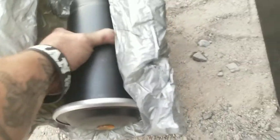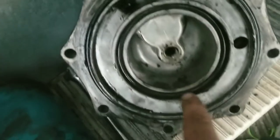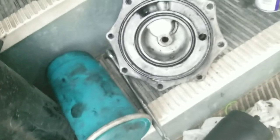This is the new one. What I didn't tell you - in the box you get a bag with instructions. Don't worry about the instructions. All there is in there is two rings: one big one for the outside - this is the new one, that's the old one. Just change them out because they give you new ones in the baggie anyway. The small one goes for the cartridge on the inside to seal it up. The other big one is for this big guy to seal up.